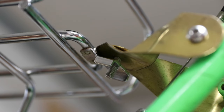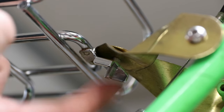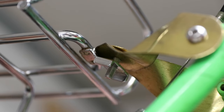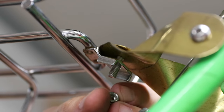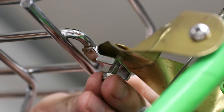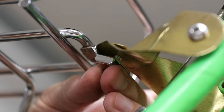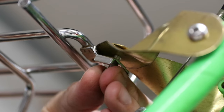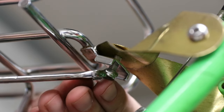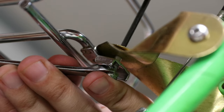It's a little bit hard to get the camera at that angle, but basically you're looking up underneath the rack at the bottom of the bolt. I just want to show you the nut I'm using — it's one of these lock nuts. Basically it has some kind of Teflon in it, so you don't really need to use a washer with this. I'm going to stick that on there, get it started — it probably won't go super far by hand because of the type of nut it is. So I'll hold it with this wrench and then tighten it down from the top.